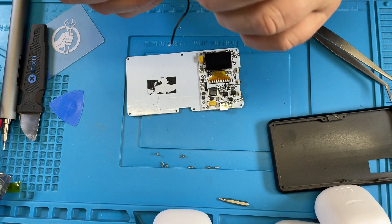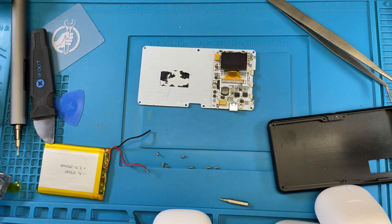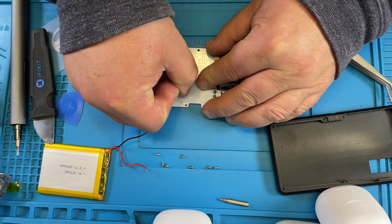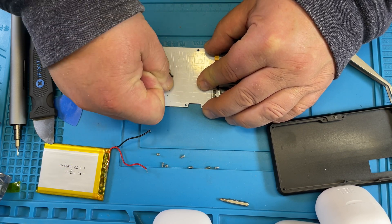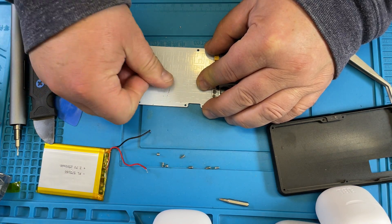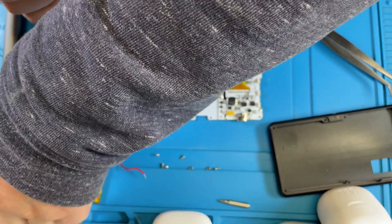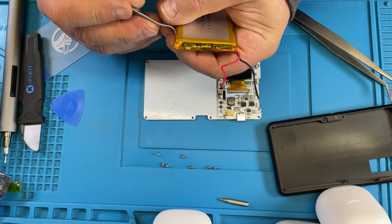Get the wires out without touching them. A fingernail does the trick too. Press it a little bit to get the glue off. Look at this — now it's clean again. That's where we have to glue the battery on again. I have this metal hook — it's not a good idea to get in here.